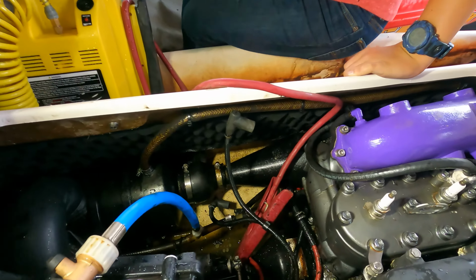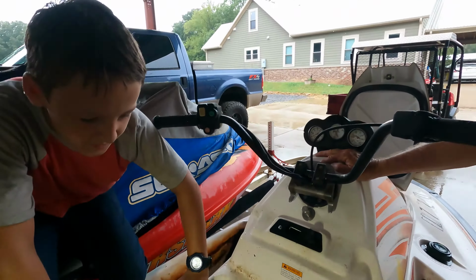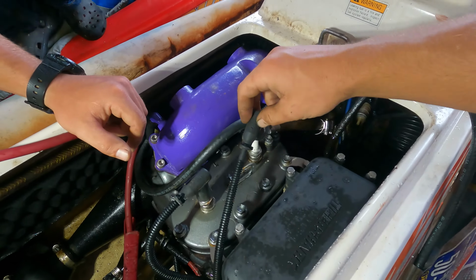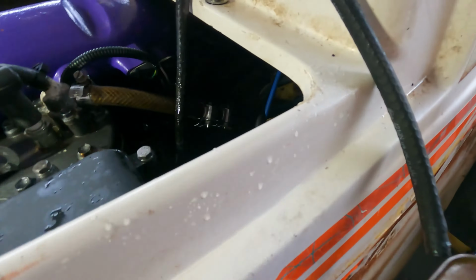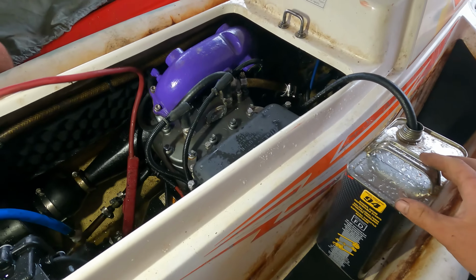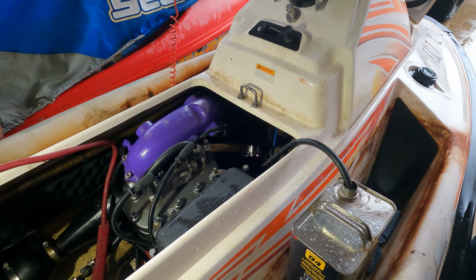It decided it was going to be diesel. It said it don't need no spark plugs. Crank it back up, see what it do. It started taking off. Chris mashed the throttle and it just kept on going and going. And Mark, it wouldn't cut off. Mark unplugged the spark plugs and it still wouldn't cut off. Still running the same. Insane. It took like a minute. I had to rip this out of the gas tank. Have to plug it up. It might blow up. The kill switch wouldn't even kill it, because all it does is kill your spark.